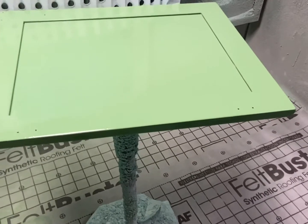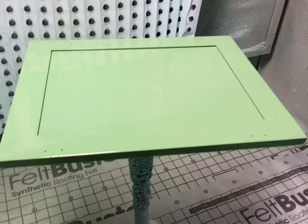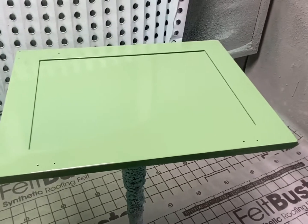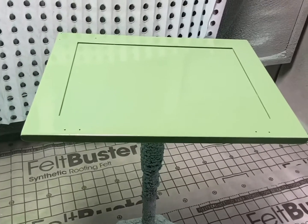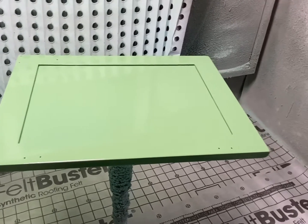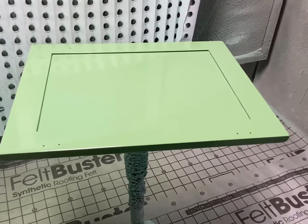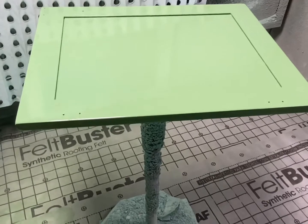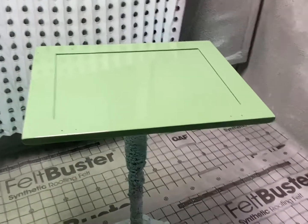To recap — this was Renner 688. Most Renner top coats can be sprayed just like this. Check the TDS sheets to see how much catalyst or hardener you need. The 688 is catalyzed at 15%, the 851 is another good product catalyzed at 10%. They also make 1k products like the 765, 1245, or 005 — you can add a cross linker or catalyst to the 765 but only about 5%. For any 2k work, I'd go with the 851 or 688 rather than the 765. Use the 765 if you want a 1k cross-linked product — the 1245 or 005 work great for that too. Thanks for watching.